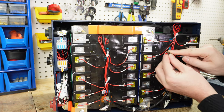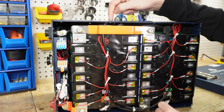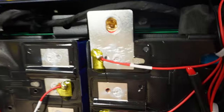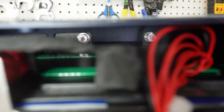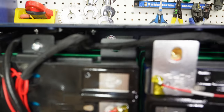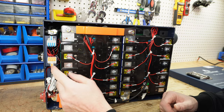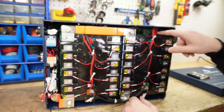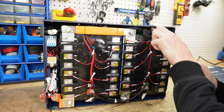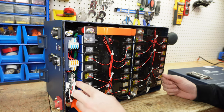I noticed this little probe here that comes around, loops in, and runs down — and there is actually fire suppression on this battery. You can see that writing there — that is the fire suppression device. Down in there, the whole battery carriage is bolted down to the case so it's not going to bump around going over bumps. And down in there is where the separate balancer is. From the balancer it comes up to these Wago connector-style things and then spreads out to all the different cells. The cells are held together with a shipping strap as well as bolts.